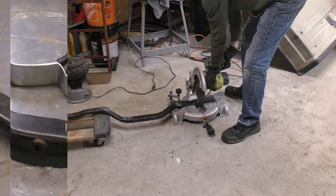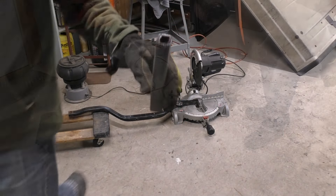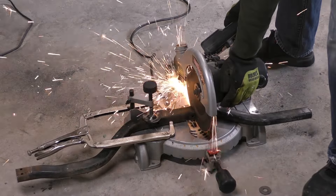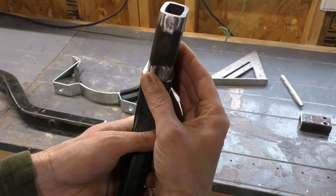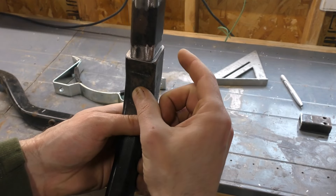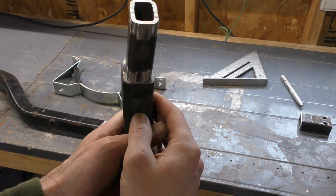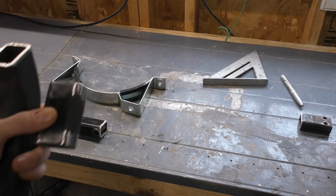As you can see, there is a difference in thickness between the base plate and the arm, which makes welding easy because I've got plenty of room to run my bead — but it doesn't match up flush. If I want to make it flush I could add some sheet metal to either side, depending on how bad it looks. I'm going to go ahead and start by getting this section welded up and we'll go from there.